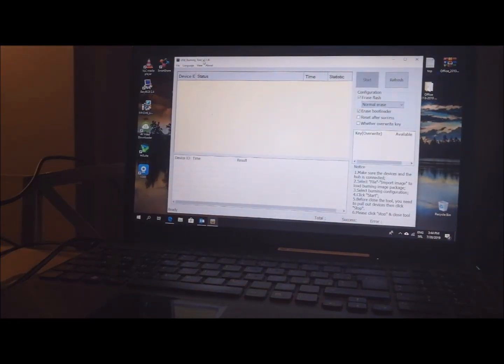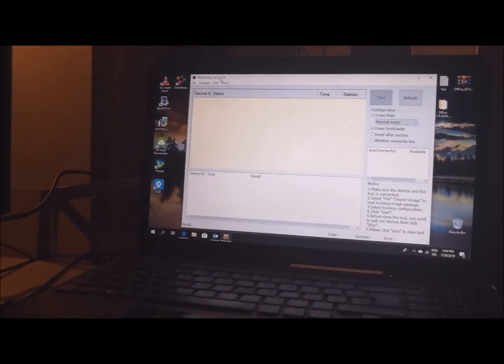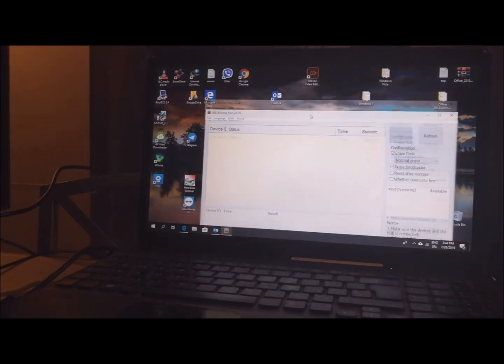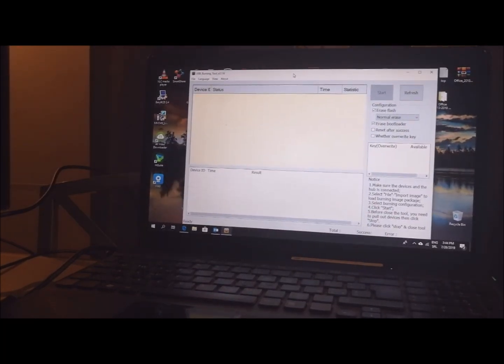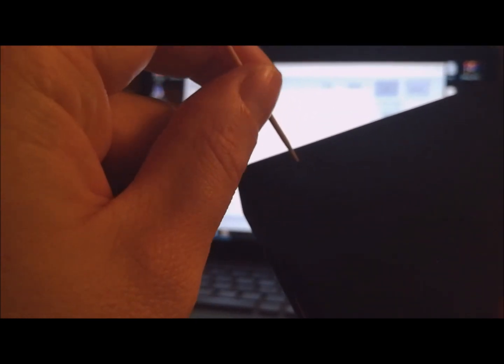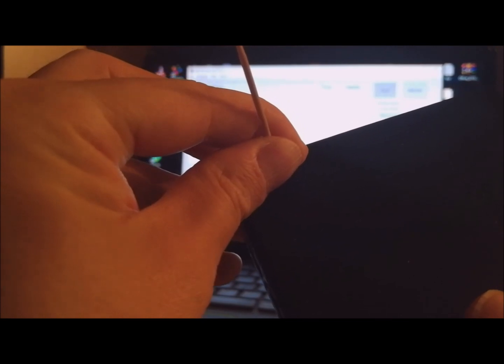As you can see, version 2.0.6. For flashing you also must prepare firmware. I downloaded that. When you run the USB Burning Tool, the next thing you must find is the place for flashing with the toothpick. As you can see on my box, this is the place, and you must press that place with the toothpick and plug in the USB cable.